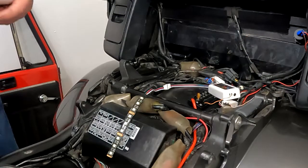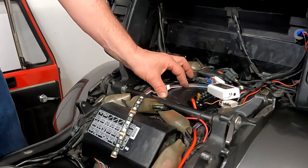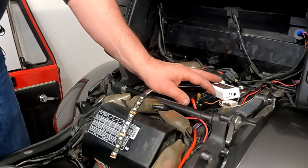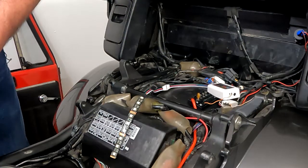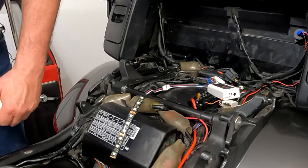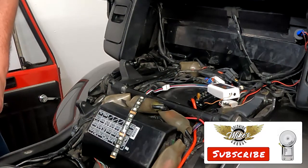We should be ready for the next step, which will be to run power distribution from this block up front — we've already got it in back. We're also going to put a ground bus right here on the back so we can run a main ground into the engine from back here, and we'll do the same up underneath the cowling. This way we have power distribution up front and in back, all fused and protected, tied into the accessory. Come back in another week — I should be ready to start that. In the meantime, look for another video about the schematics around all of this so I can get it out of my head, get it on paper, and you guys will have something to follow along with. Until next time, take care. If you like the video, please hit the like button, subscribe to my channel, and hit that little bell so you can be reminded when the next one in this series is coming up. Take care, guys.